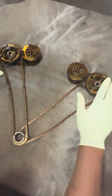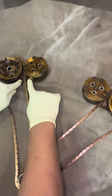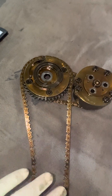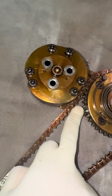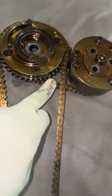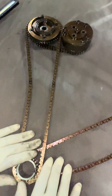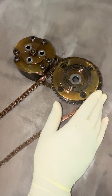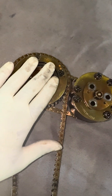Let's look at this setup as it is. You have four cam phasers and four timing chains. One timing chain for one cylinder head, another chain for the other cylinder head for the cam timing, and then you've got two more timing chains — again, one for the driver side cylinder head and one for the passenger side cylinder head.